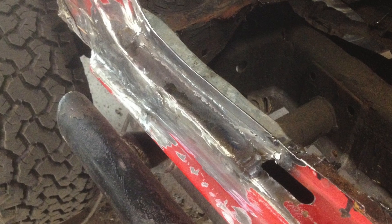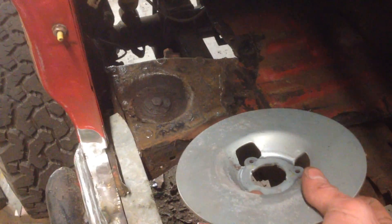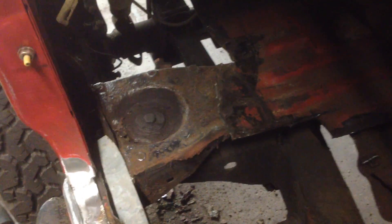It's going to be a long process. I think I'm getting the difficult part first — this area you're not going to see, so it can just be some flat sheet metal, which I've got plenty of over here. This mount has actually started to bend the floor up because that metal has gotten so weak. I found these unique little things that will make a perfect new area for the body mount, so it's coming together — a little longer than planned, but so far so good.